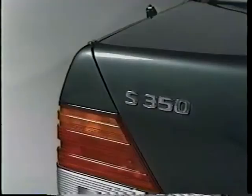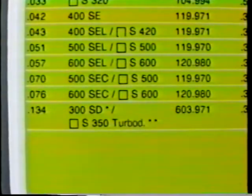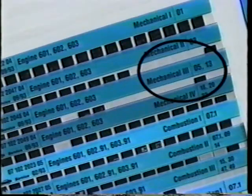For our S350, for example, we determined that the model ID is 140134. Model 140 is located on the card, then the second three digits and the engine identification for the engine installed in that vehicle is listed in the engine column. So the engine in this car is a 603971. Several fiche may be provided for that engine. Just like the body fiche, refer to the group system card to locate the group number assigned to the system or component involved. For example, if the job is replacing a camshaft, the valve train is in group 05, and this fiche would be selected to perform the job.